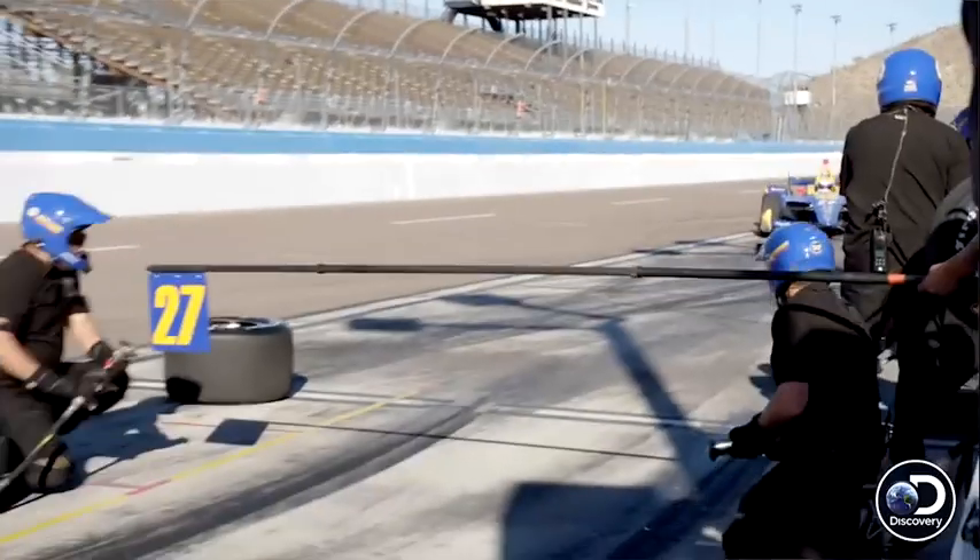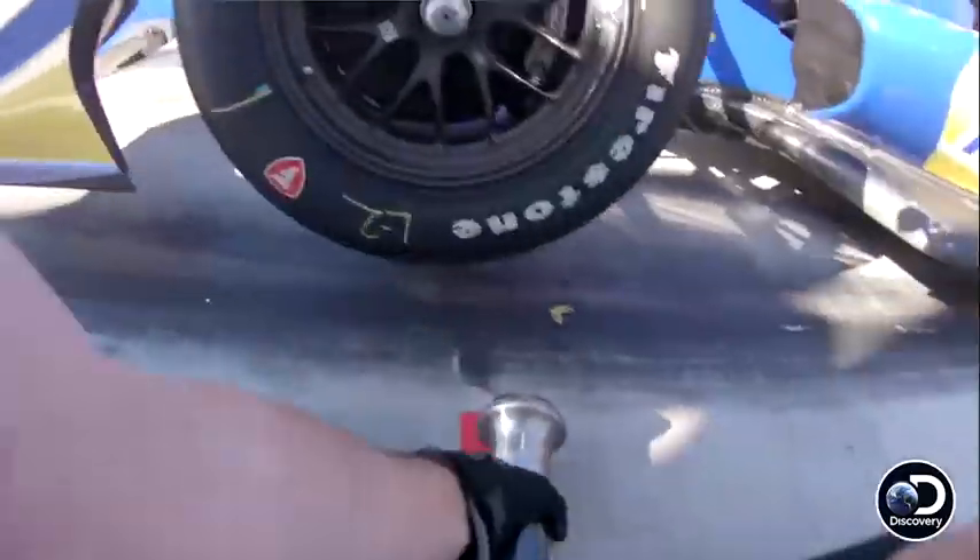The best thing to do is play with the adjustments at your disposal and start understanding what it feels like when you make those changes. Often with drivers we'll do two or three back-to-backs on different things, and what they say guides us — try three dampers and they guide you for the fourth that might be the optimum. We first have the driver test it in the session, and since the session is so short — typically a one-hour practice — you're going to get a maximum of four changes. So we have the driver go out, try it, and they give us their feedback.